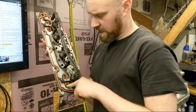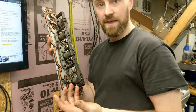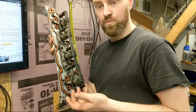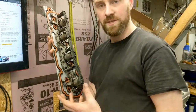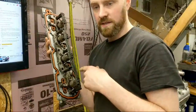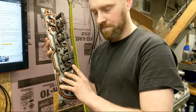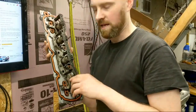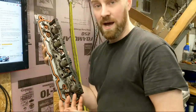So the tower that sits under here, if you get oil pressure there, it's going to do that exact thing where it will collapse when there's pressure applied to it, but it'll have enough spring pressure to hold it tight and keep it from ticking. Basically, it's acting just like when the system is enabled, but it's not actually enabled. It's a failure within the VLOM unit, and it's backing up pressure on this end, and it should not be backing up pressure there. Cut these gaskets, or go through my VLOM mod.